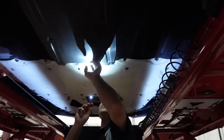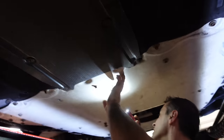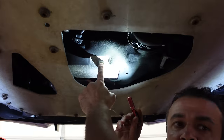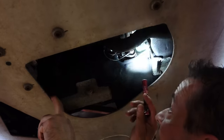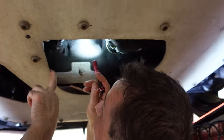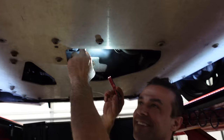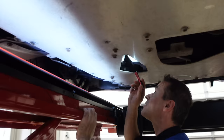I'm just glad this is all nice bare aluminum and not rusted old metal. And then you've got the carbon fiber right here - this is so cool. That's your filter and that's your oil drain. So that is super easy. I'm very surprised the filter is facing down on a BMW. Make sure you drain this so you won't make a mess. Zero corrosion - this is freaking awesome.